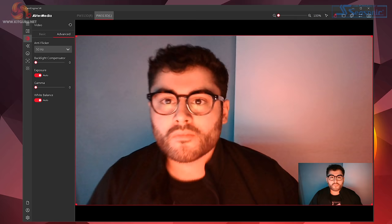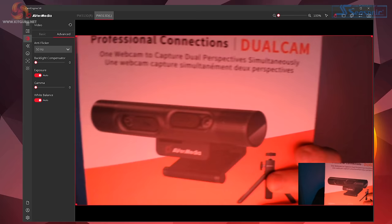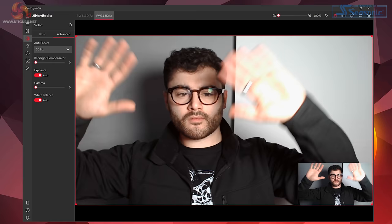Before we head into the software, here are a few samples of the cameras' quality. First, let's take a look at the left webcam, which is only 1080p 30fps. This camera looks okay — I wouldn't say it's great — and unfortunately it's quite tight due to that 71-degree field of view. Looking at the left camera in different situations such as low light, you can see it actually handles low light pretty respectfully, with only the monitor's light being used here. Although there are definitely some hot spots on my face, showing the auto exposure isn't quite right and is slightly overexposing. The image is also breaking up a little bit and doesn't look as clear as when using artificial light or natural daylight. Autofocus is also a little sketchy in low light, often hunting to find the right spot to focus, but this is expected.